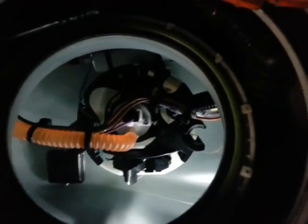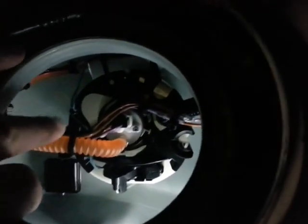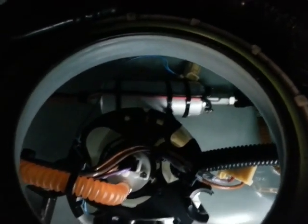As you can see down here, you can see pretty clearly the float sensor, and that goes towards the front of the car. But you can see my plumbing comes out the left side, and actually if my top hat was in place it would route back behind here like so, and then you can see that goes down around — and there's my 255 inline pump. That needs to be near the trunk side of the bucket so it doesn't interfere with the float assembly.